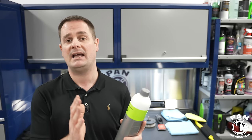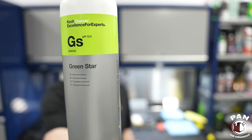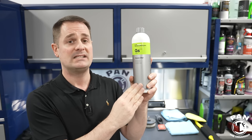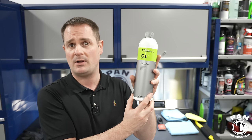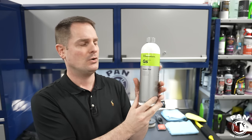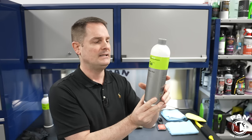The first product is usually an all-purpose cleaner, more for the hard surfaces — your plastics inside your vehicle, your trim and that kind of stuff. One that I like is Koch Chemie Green Star. It can be diluted many ways, but for interior surfaces on regular maintenance, you can dilute it heavy, medium, or light duty. For light duty it's a 1-in-20 dilution — one part product to 20 parts water. When diluting products, try to use distilled or demineralized water; the better the water quality, the longer the product will last and the better it performs. Green Star is a great all-purpose cleaner for hard surfaces, with a pH of 12.5 — it's an alkaline cleaner that helps to degrease. It can be harsh for softer or more fragile materials, so use it on your hard plastics, the dashboard, that kind of stuff.